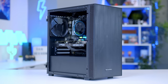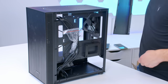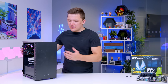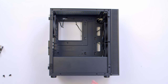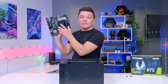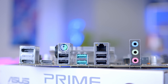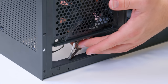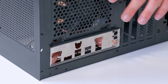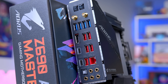What I recommend you do with any case, no matter how small or how big, is to take off as many of the side panels as you can. For us today, that means the rear steel panel and the front glass panel. We're going to lay the case down flat on the table, because it's going to make the next stage of the build so much easier — taking our motherboard and popping it into the case. Before you whack your motherboard in and start screwing things down, check whether your motherboard has a built-in rear IO shield. If it comes with a separate piece of metal like this, it doesn't, and we need to install this now. Pop it into the rear rectangular cutout on the case — it clips in corner by corner, and it can be quite sharp, so be careful.